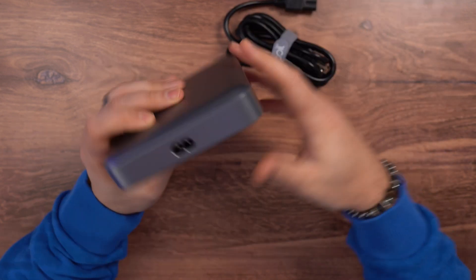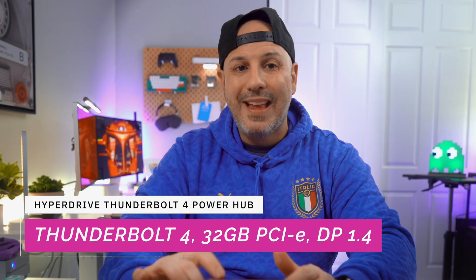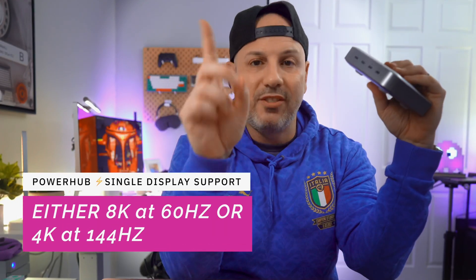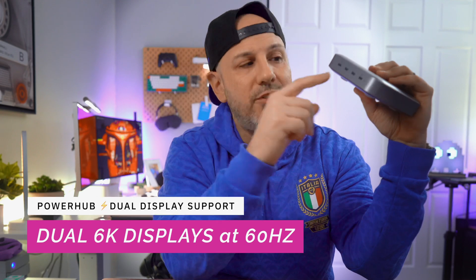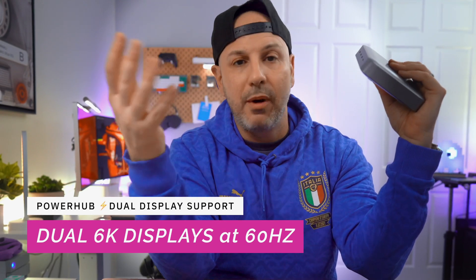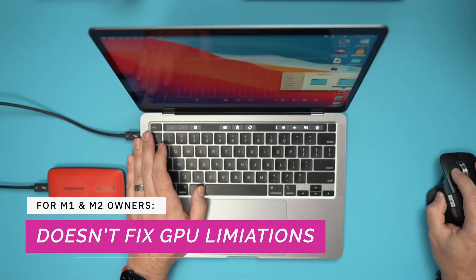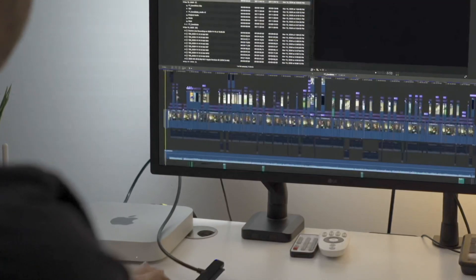This unit is currently only being sold in the United States. Second, since the Power Hub uses the newest Thunderbolt 4 controller — Goshen Ridge — it has better graphics performance thanks to 32 Gbps of onboard PCIe bandwidth shared between all four Thunderbolt 4 ports. All four ports support DisplayPort 1.4 fully. The Power Hub can support a single 8K display at 60 Hz, a 4K display at 144 Hz, or two 6K displays at 60 Hz, giving it broad compatibility with many displays on the market — assuming your PC or Mac can push them. This does not circumvent an M1 or M2 device where it can only push out to one display; that hardware limitation still exists on the host side and this will not solve that problem. So do not buy this product if you're looking to output your Mac to more than one display if your Mac only supports one.